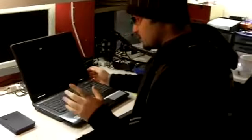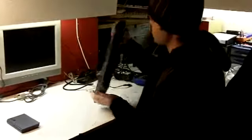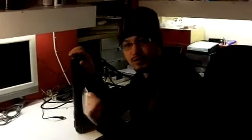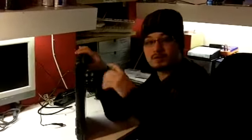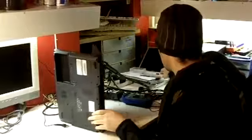So now I know that my charger is working, but my laptop is not. So how to do this is, there are two suggestions. Either the DC socket, which is a very common problem, where your charger hooks to, is broken, not working anymore. Either it's loose or disconnected, and it's a very, very common problem. Or there's a voltage regulator, which is extremely hard to do for you as a normal user, which needs an expert to look at and replace, or it could be the whole board that's gone and it's not worth repairing. But mostly it's the DC socket.